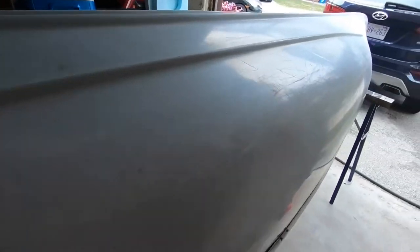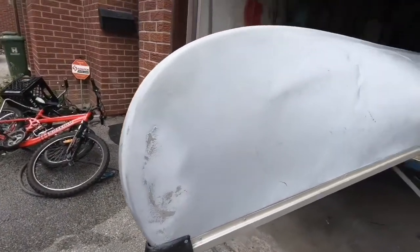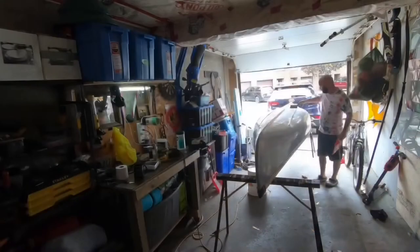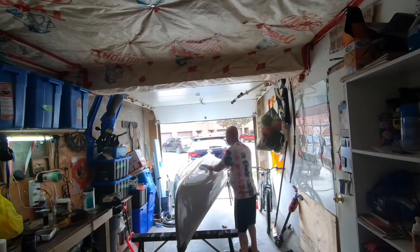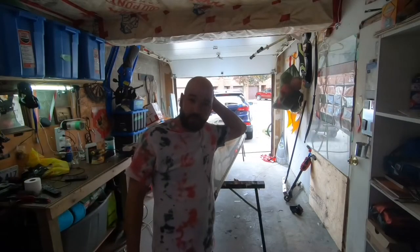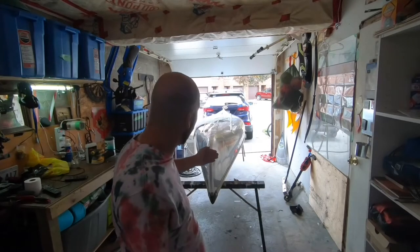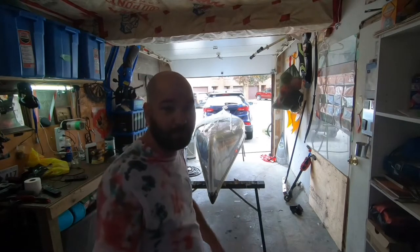There are a lot of spots here — we sanded a hole right through it last night, but I guess that's what we're looking to find. This side of the canoe looks pretty good. There's a lot of work here though. The patches someone did before are pretty strong so I'm not going to pay too much attention to them. The keel's got a lot of work to do. Now we're cutting the fiberglass mat into sections the size of our holes. Because the resin hardens so quickly, I'm going to focus on doing about a quarter to a third of the canoe at once. I may run out of fiberglass mat — it may be a 65-pound canoe when I'm done instead of 53.